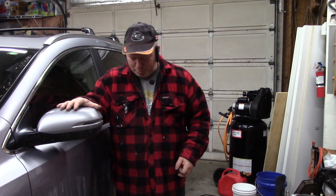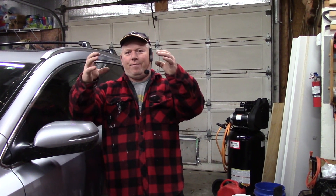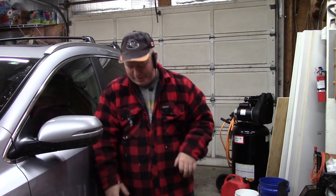Welcome back to Rob's Garage Woodworking. Today we're going to talk about drive shaft noise on the CRV. So if you've got a CRV — ours is a 2017 CRV — and you hear some weird clunking when you back out of your driveway in the morning after driving in snow and slush, chances are you've got a slush buildup that can get up around your drive shaft, fall on it, and refreeze.